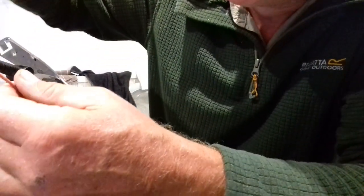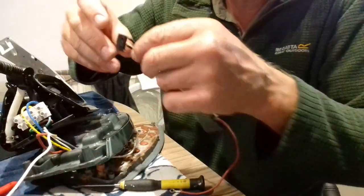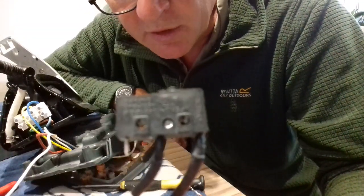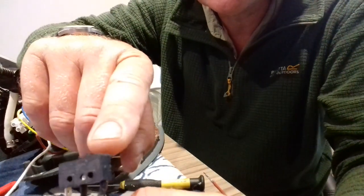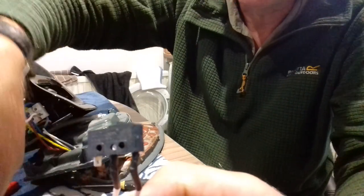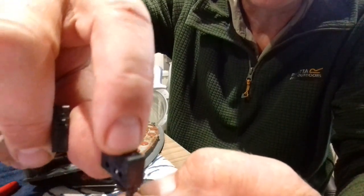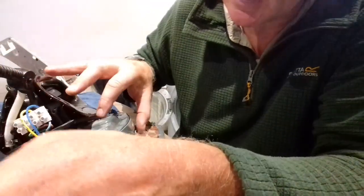These aren't my glasses — they're my girlfriend's, I can't find mine. Anyway, you can go on eBay and order these switches. They come with a slightly different switch cap on there. You can hear the difference between a broken switch and a good one — there's a little plastic switch broken inside the bad one. This is a good switch I'm going to take out of here and put into the other iron.